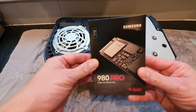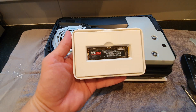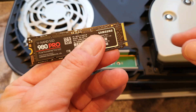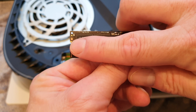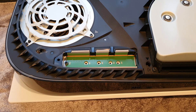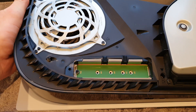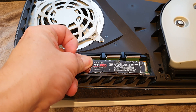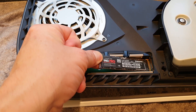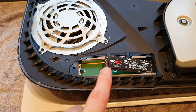Let's remove the SSD from the box and offer it up. Very nice indeed, and very dinky. As you can see, we have a notch cut out of one end of the SSD, and this end is where a screw will attach to hold it down in place. If we look closely at the PlayStation, we can see it has the same notch. What we're going to do is offer up the SSD at an angle — a lot of people want to put these in straight and push them in, but that is incorrect. Just line up that SSD at an angle, push it in gently. It will sit up proud like that — that's perfectly fine — then just push it down, and that is how it will sit.